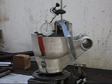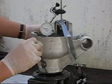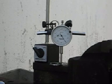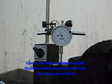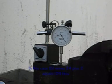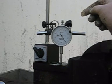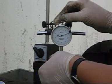So now I've got my dial gauge mounted with some gaffer tape, and it's resting on the end of the driveshaft yoke. I can now measure the end float by levering the hub up. It's reading 24 thou. So the spacer I took out is 151 thou, the measured end float was 24, and the target end float is 2. So we need a spacer of 0.129 inch. It just happens that the one I took out originally is 0.130, which is just fine.